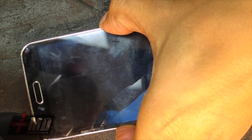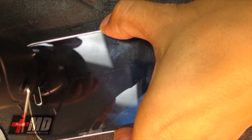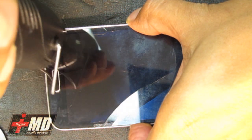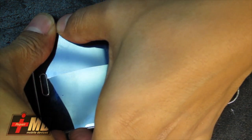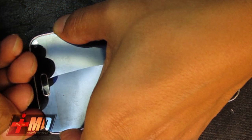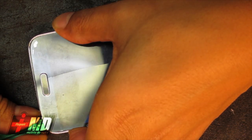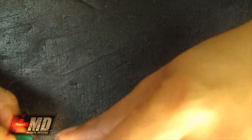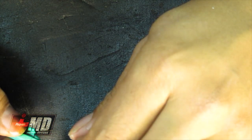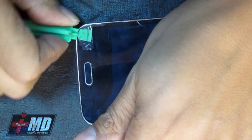You do have a flex cable down here so let's go ahead and pull this off. Again, this one has already been damaged from the drop — both LCD and digitizer are damaged — so all we really want to do is open up and replace the digitizer and LCD. What we're trying to rescue is the touch cable. Just like the S4, the home button, back button, and info button — you want to protect those. So I'm putting some pressure down here.